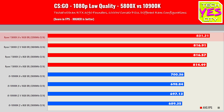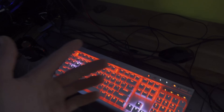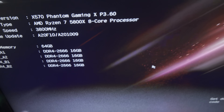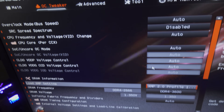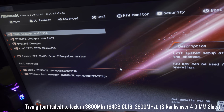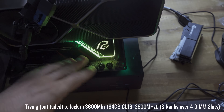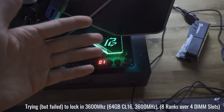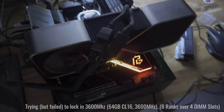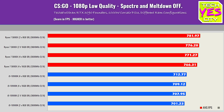Except for the 831 result on the eight ranks over four sticks. The thing about eight ranks — I actually couldn't get this to work at 3600 megahertz; I had to drop it down to 3200 megahertz because that's all it would boot on the 10900K. I think it booted 100 megahertz higher on the AMD system, but on both systems it would not lock in 3600 megahertz over 64 gigabytes. Now we're also pulling up the Spectre patch disabled on the Ryzen 7 5800X and both Spectre and Meltdown disabled on Intel, and we can see some performance differences there.